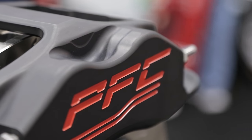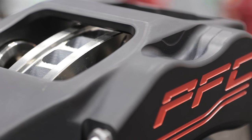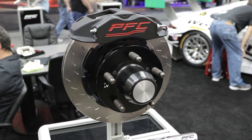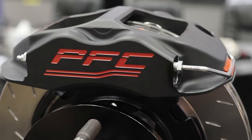Let's start with the caliper — what's going on with the caliper here? The caliper is actually our one-piece monoblock design. It allows for a lot stiffer pedal feel, a lot less drag, and actually allows for a lot cooler temperatures during those summer months when these guys are trying to keep their brakes under them for 150 laps.